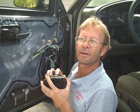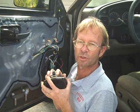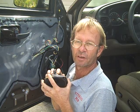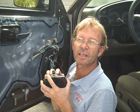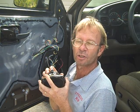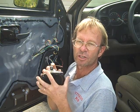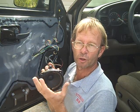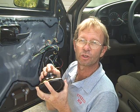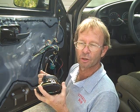One of our reasons for putting this video together is the most common question we get asked when it comes to installing aftermarket speakers is, I've installed new speakers, but I don't have any bass. The reason for having no bass is a speaker is out of phase. It's important to get the positive and negative phasing correct so that you get the correct frequency response. When a speaker is out of phase, the bass notes tend to cancel out in midair, so you wonder why you're missing bass. It's because one of the speakers is out of phase. This is a test that we're going to show you so that you can take care of the proper installation and hooking up the wires properly to the new speaker.